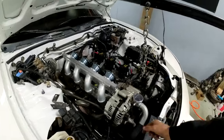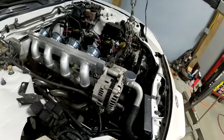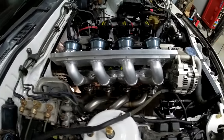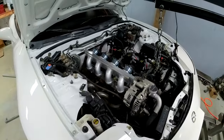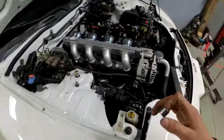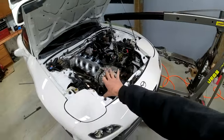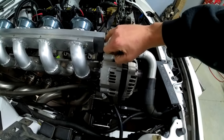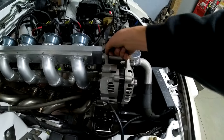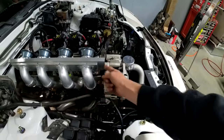On my way through town picking up the pilot bearing, I stopped by and the intake manifold is already fabricated and welded up and it looks so good. I've got my bungs back here for the brake booster tie-ins — I tried to keep them out of the way so you don't see them when you're just taking pictures of the engine bay. If you're taking a nice three-quarter shot, you're not going to see them. And look at this — it clears the alternator by the skin of our teeth. We've got probably a dollar's worth of space in there, which is a huge win. Pilot bearing and clutch plates are back under the car, putting this very complex but yet simple multi-plate clutch together.